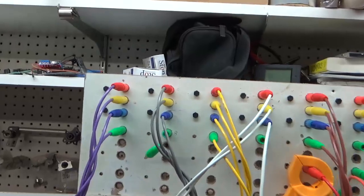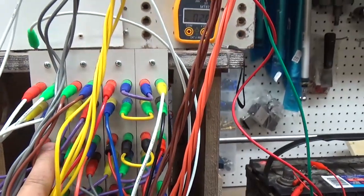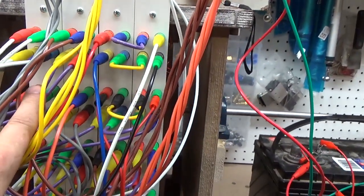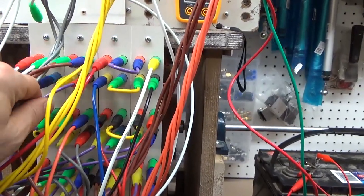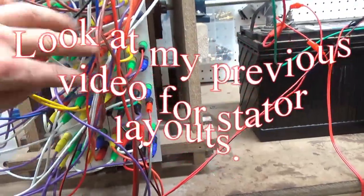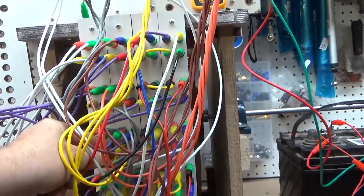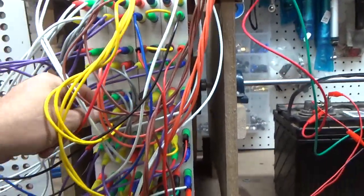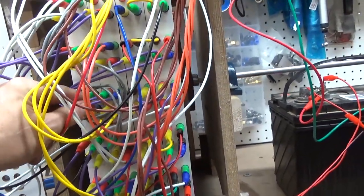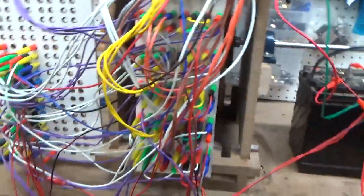These go out and trigger a transistor behind here. These go to a trigger coil — you can see on the first set, I'll trace them down. They get a trigger coil, which would be a stator. That's actually the power coil, and then the other one goes to stator two, and it should be three down below that, which would be stator two C1 coil.